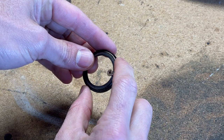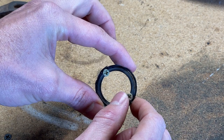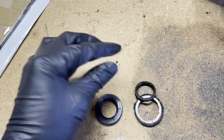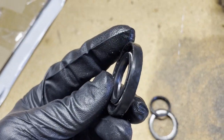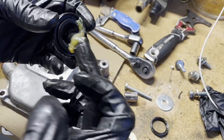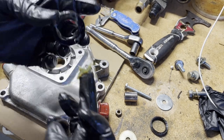Then you can tap in your new one around the crankshaft. Because this was so tiny and there's so little to work with, I decided to take the side off of my engine altogether. This is the original — because it was so worn out, now it's in two pieces. Before we put the new seal on, notice there is a little spring that goes around the interior of this seal. I'll put some grease around that to keep the spring seated and prevent rust, and I'm also going to lube up the exterior as I slide it into position around the crank.